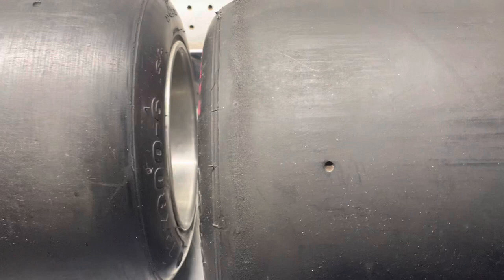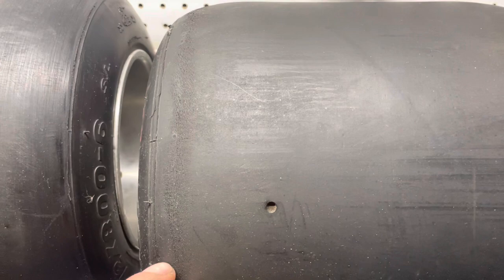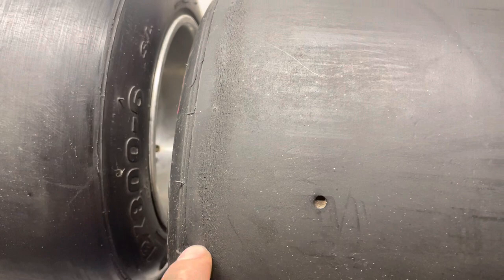If I'm not mistaken, this is the tire I ran in 2019 at the Grand Nationals in Jasper, Florida. And as you can see, G-forces are pushing down and pushing this way. I was running, if I recall correctly, like eight pounds of pressure in this tire. Air pressure really wasn't the case — it was just the amount of grip that Jasper, Florida had. It's very grippy and the inside edge is pretty much destroyed. Can I flip it and get some more run out of it? Absolutely. But instead of the wear bars going down, you lose the edge, which makes the tire not as fast.